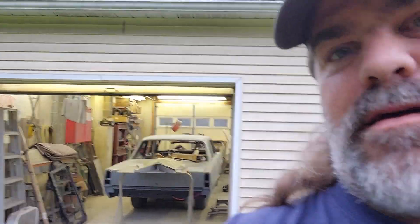At some point I gotta get back on that Valiant in there. I was hoping to get it painted this year before it gets too cold, but it just keeps needing little things. Still gotta mount the hood — I'm putting hood pins in it, so I made all the brackets and stuff for that. If it doesn't line up where I want the pin to come through the hood, I still gotta prime the hood — I didn't want to prime it until I had all the holes drilled in it. I think there's a Cameo coming in that needs some paint work, and a '67 Vette that needs some fiberglass work and then paint work.